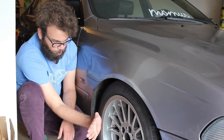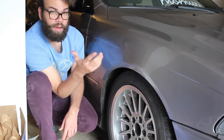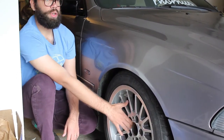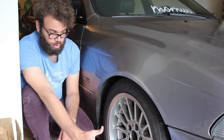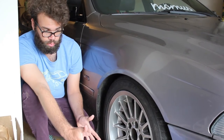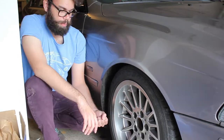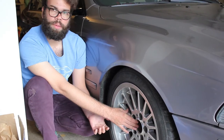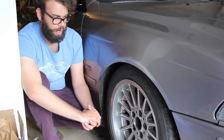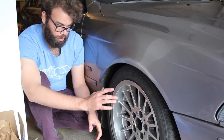Another mechanical fault that recently developed — again, a typical BMW thing — is the wheel bearings. On a car that is now 20 years old and has more than 200,000 kilometers, it's only to be expected and should be taken into account for normal maintenance. The wheel bearing has to be replaced. It's starting to make some noise when cold in the morning, which goes away once you drive a bit, so it's showing excessive wear.